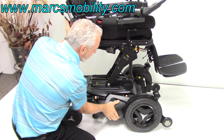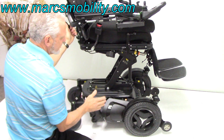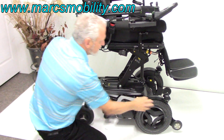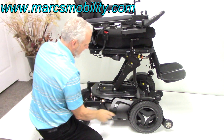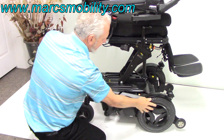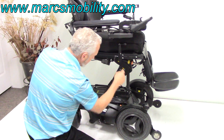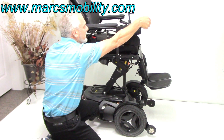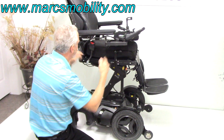There are two motors. The motors go from here forward to the wheel — all direct drive. If you need to put this chair in neutral: this chair weighs 400 pounds, you can't really push it if it's in gear. But if you want to push it, turn the power off on the joystick and you have a neutral lever on both sides for each motor. Push it down and you're in neutral. Push it back up and you're back in gear. Always turn your power off when you put it in neutral, because you'll still get resistance even if the power is on.